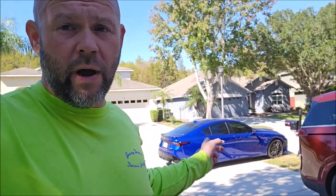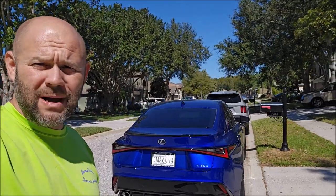Traditionally people complain about fillers, but if you don't want to spend hours on paint correction, you don't have to. I did a whole 2012 Corvette yesterday with this same system — polished it with Mr. Hyde and my DeWalt DA with a Buff and Shine orange pad — and after all the prep and ceramic coating, I spent two hours and twenty minutes on that car total. With this Lexus we're using the same system because it doesn't need major correction. I want to polish it, enhance the gloss, make it look amazing, then ceramic coat it.